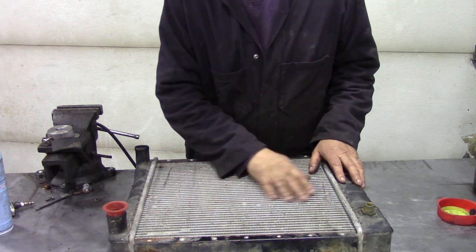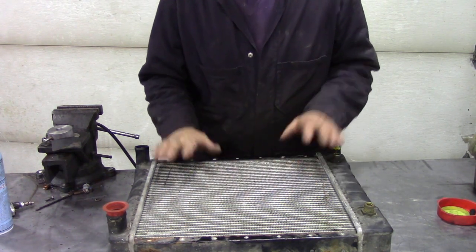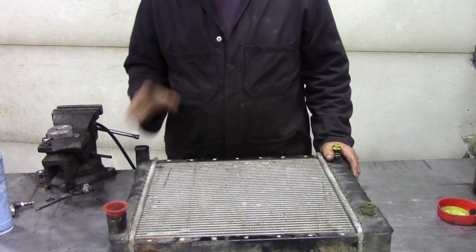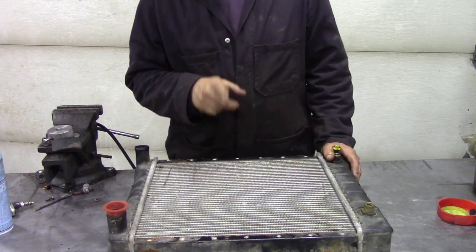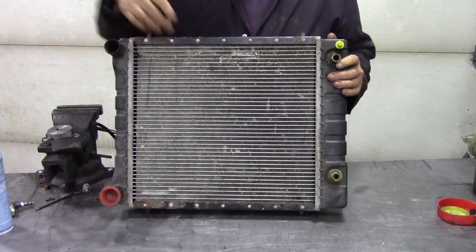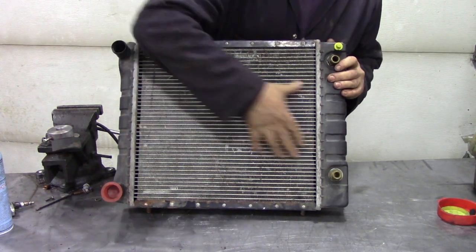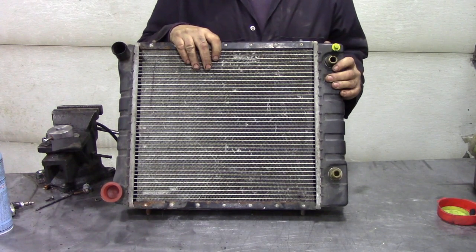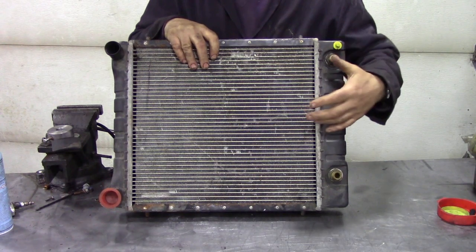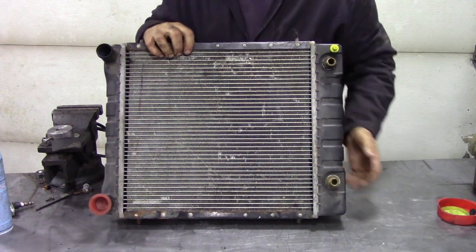And if you see after that that the fins have disappeared, get another radiator — because they don't leak. That's the most frustrating part. People think a radiator's finished because it leaks, but that isn't always the case. If you lose all the fins out of, say, 75% of the radiator, you've lost nearly 80% of your cooling. You've only got a small band that's actually doing cooling, because the air's going to pass straight through and do nothing.